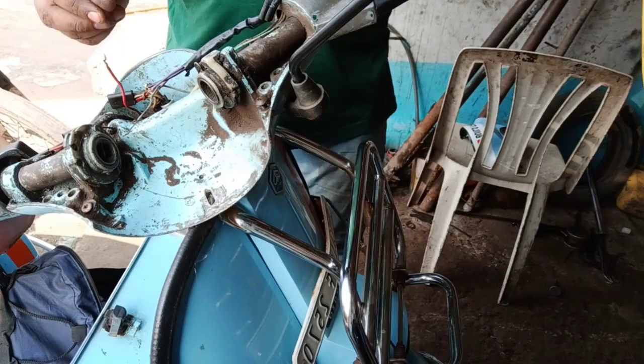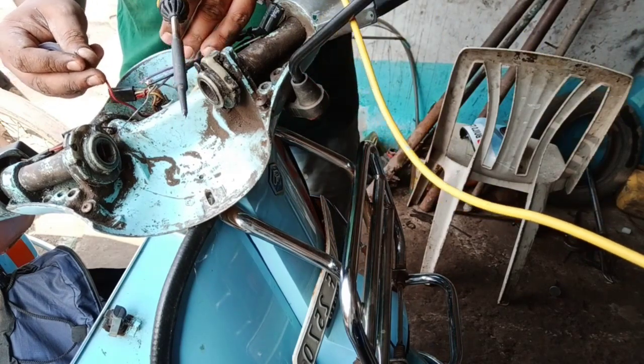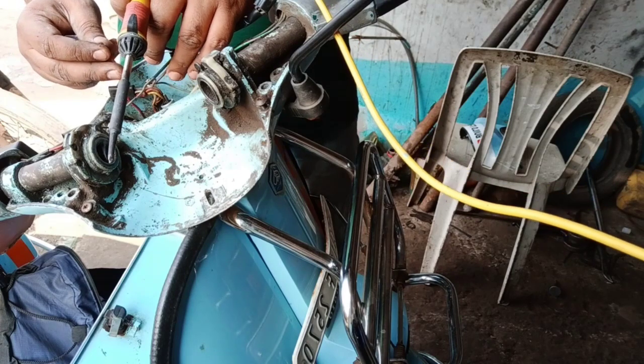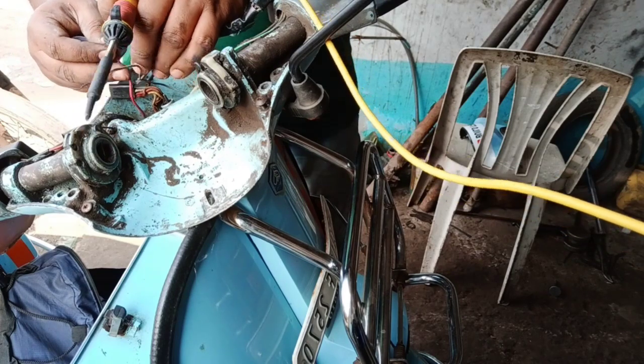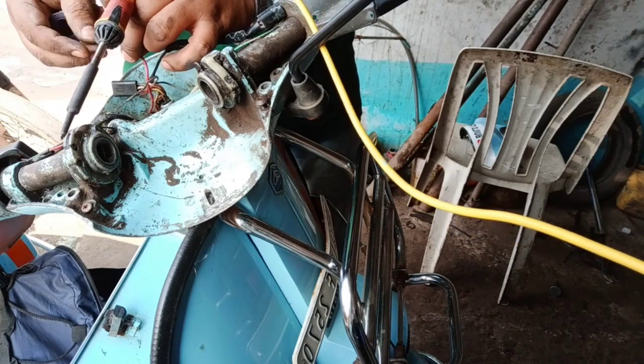Meanwhile, the socket that we took out from the older scooter was soldered onto my scooter's electronics, and that was a really necessary task, because without that we were relying upon winding the wires with each other, and that's not a really great way to go ahead with making proper electrical connections.